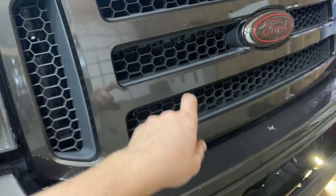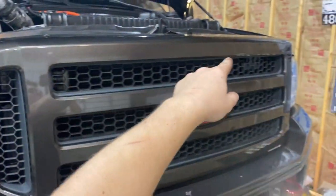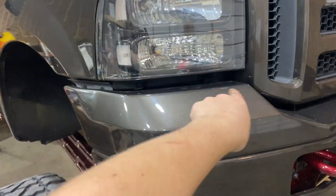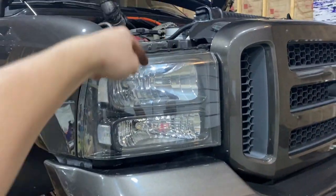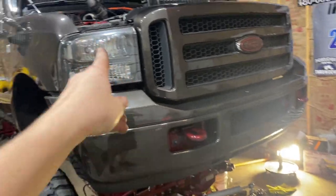Also the grill, you will have to take off the grill. There's 4 clips down here on the bottom and there's 4 bolts at the top. So you just pop that grill out and then you'll be able to take the 2 screws out of the bottom and 2 screws out of the top on that headlight and pull that headlight out. So I'm only gonna put one of them in